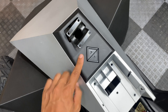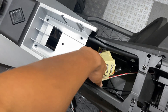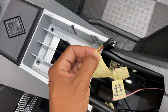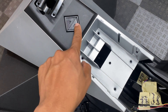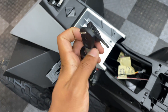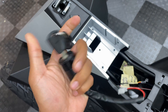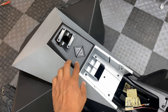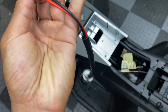After taking a closer look at the bottom side of the switch panel, I've decided to keep the forward and reverse switch in place and repurpose it as an on/off switch, since it essentially does the same exact thing. It's just two wires — one setting breaks the circuit and the other completes it, which is exactly the same thing an ignition switch does: you key it on, it completes the circuit; you key it off, it breaks it. I think it looks a lot cleaner to just keep this in place and install the same two-pin style connector from the ignition switch.